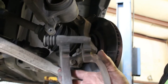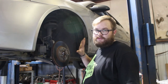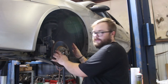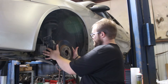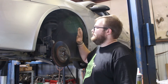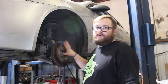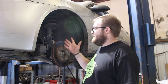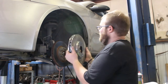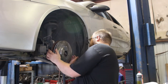The caliper bracket is off. Now that the caliper and bracket are removed, we're ready to get the rotor off. Mine is just held on by the wheel as I said; you may have a flush Phillips screw here that you'll need to remove first. Before pulling it off completely, I'm going to hold the old rotor in place and test-fit the new one against it — this car has two different rotor sizes depending on trim level and engine size, so always verify you have the right part.